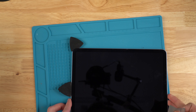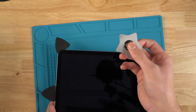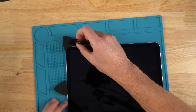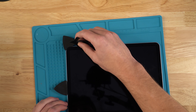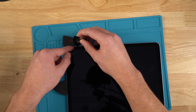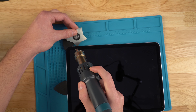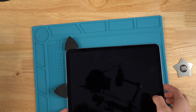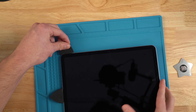If I see a very big crack that doesn't seem to want to lift up, I'll come back in with my metal spudger and do what we did in the beginning — insert it in between the housing and the LCD and pry it upwards, then try to use my pick to get underneath it so I can continue without the screen cracking further. And as you can see, I did get the other part of the cracked screen under the pick, so now I can proceed forward.